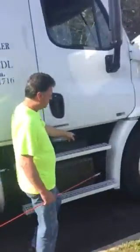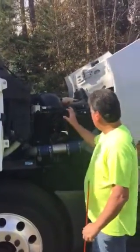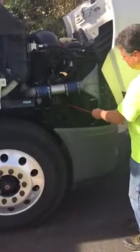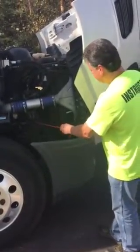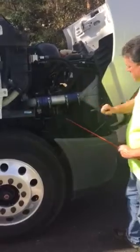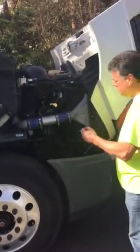I follow the exhaust all the way to the engine compartment. Once I get to the engine compartment, I start with my hoses. My hoses are not cut, cracked, dry rot, or bulging, and I hear and see no leaks. From there, I move to my alternator — it's not bent, cracked, or broken, missing nuts, bolts, or screws, and it is belt-driven. Then my alternator wire: it is not cut, cracked, dry rot, or frayed, and I see no signs of burnt, damaged, or exposed wires.